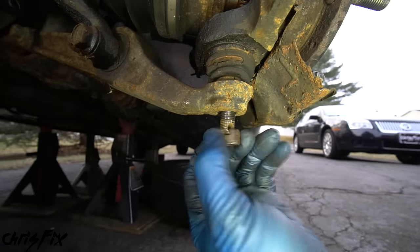With this control arm removed, we have officially removed everything in this wheel well, and it wasn't that difficult. In most cases all the fasteners came off pretty easily — if they were hard to remove, just use a breaker bar and make sure you spray everything with penetrating fluid. Now, out with all the old suspension parts and in with the brand new ones. We need to get the knuckle and remove the hub, bearing, and ball joint. Since everything is removed, I'm going to clean up everything in here, hose it down, and put a fresh coat of paint to prevent rust. Clean the wheel well first to remove all dirt, oils, and grease, then spray with soapy water as a degreaser and brush everything down, followed by a final rinse.